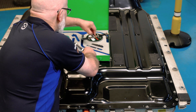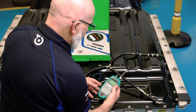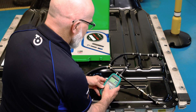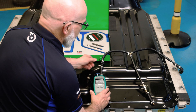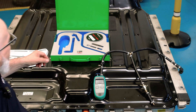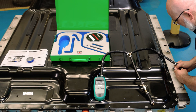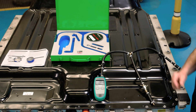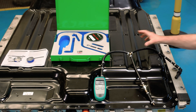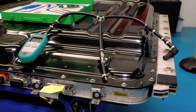Now we need to assemble the kit and do a pressure test. Pull the kit out of the box, close the valve, and switch it on. Currently it's reading zero zero because it's reading from atmospheric pressure. Now you can see it's gone up. Leave it alone — don't touch it because the heat from your hand will raise the pressure. Just leave it be and let it settle.